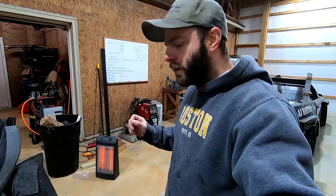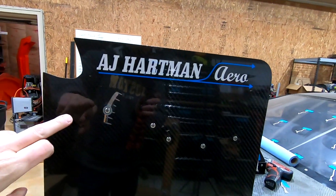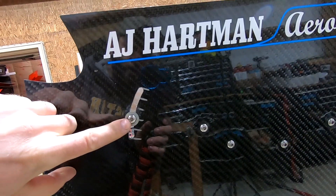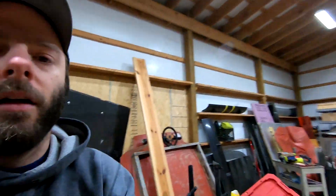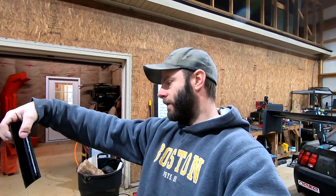So I can effectively say at about 100 miles an hour I'm removing about 50 pounds of downforce off the front of the car with this change. I'm also adjusting the wing — you can see the mark — I pulled a little bit of wing angle out so the aero balance should stay pretty good.